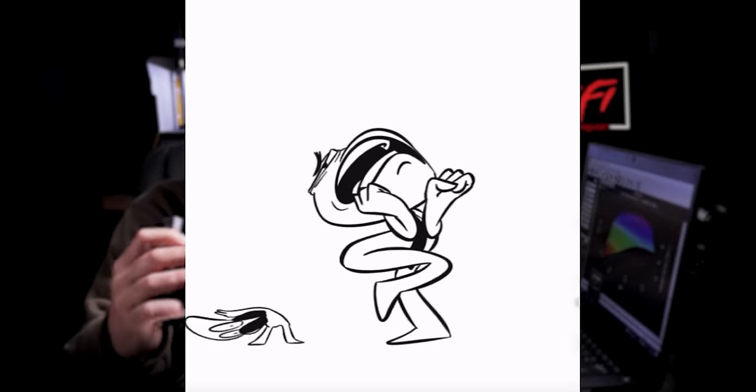Now on to the cons of the Terminator X. It has a plastic non-potted case — it's not as robust, durable, or waterproof. Once you pick up one of the HP or Dominator ECUs it just feels significantly different. The Terminator X will only run high impedance injectors, so basically you're limited to around 210–220 pound injectors depending on which brand. If you want to run something like a billet atomizer injector, you can't do that on a Terminator X — though considering you can't run methanol with the Terminator X oxygen sensor, you're more than likely not going to be running that type of injector anyway.